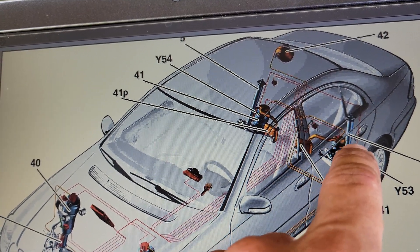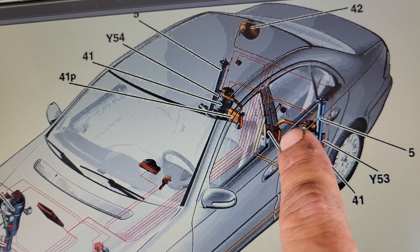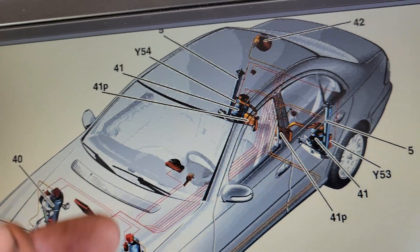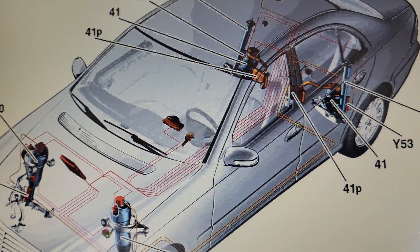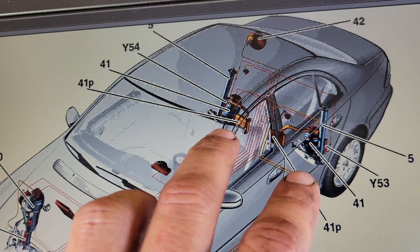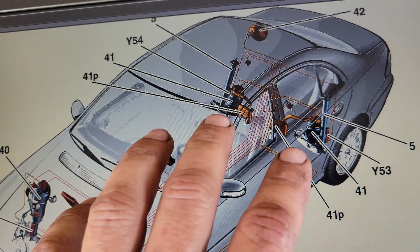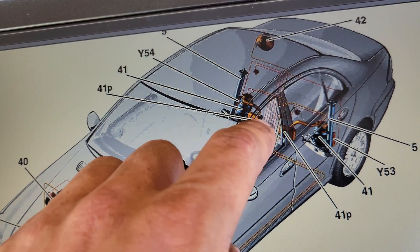The system can also close off the air volume to increase the spring rate — pretty ingenious. The problem is: this is an aluminum tank in Ohio, and we get salt. Aluminum will corrode, and what happened over the years is salt got up on the aluminum nipple on these pillow tanks, causing pinholes. That caused my car to leak for years. That prematurely wore out the pump, and eventually because the car kept sitting down all the way, it killed the air springs — they were getting pinched and ripped.